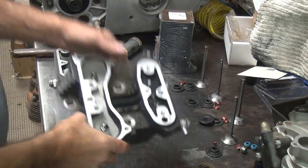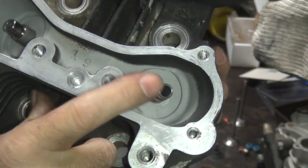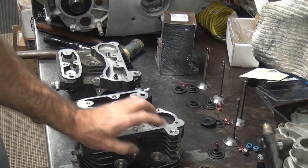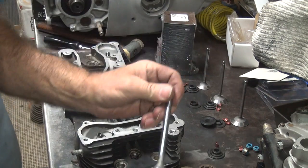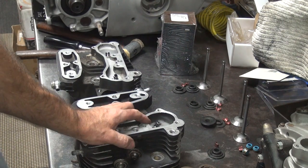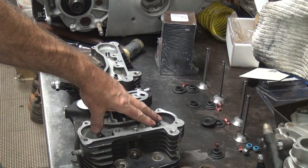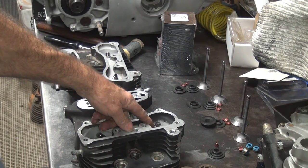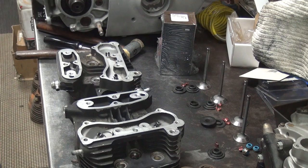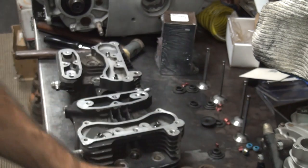We're back - I got the guides cut down. I ended up cutting to 750 instead of 700-725, because I got a little more clearance than I thought I had. The only reason I had to cut them this short is because we have a very short installed height for the spring and the valve stems are really short - they're not poking through the guide very far. Normally you don't have to shorten these guys anywhere near this much, but I'm figuring on running up to 600 lift and potentially a big cam later.